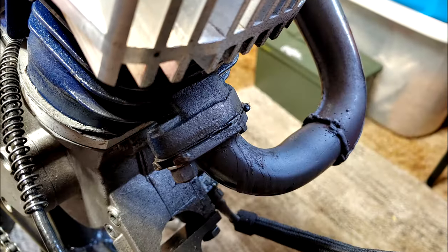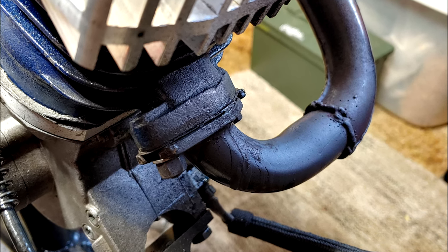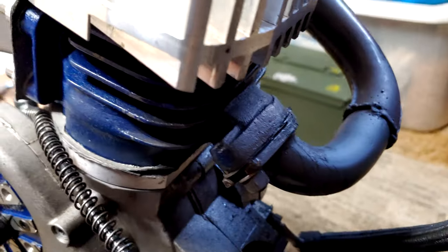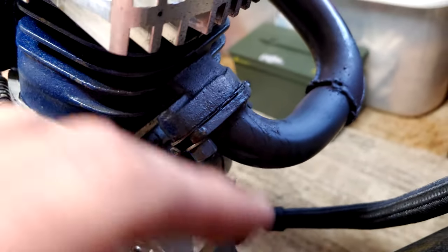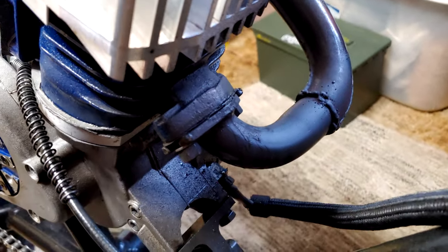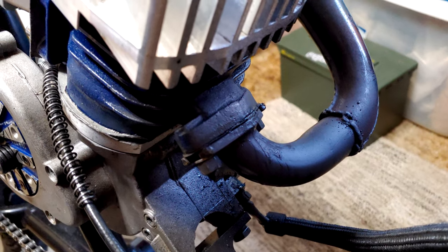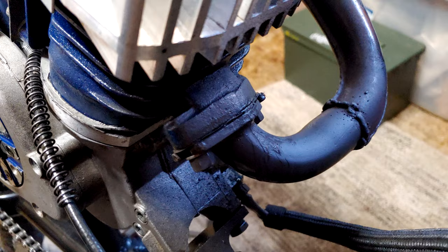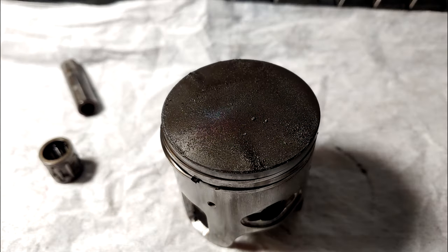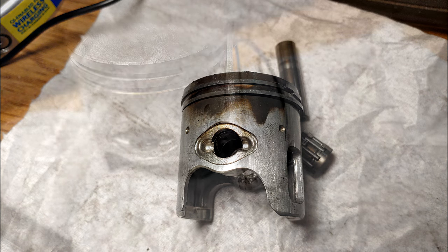It was when I noticed this dark gray flaky material seeping out of the exhaust port that I put 2 and 2 together and realized I screwed up. Don't get me wrong, it's not like I just gave the cylinder a quick wipe and put it back on the bike. I did go to town with a scrub brush and soapy water after the parts cleaner proved to be ineffective. But I definitely could have gotten more enthusiastic in the transfer ports and underneath the intake adapter with Q-tips, which I just didn't think about.